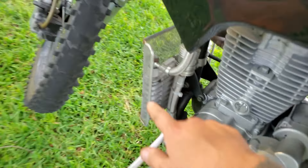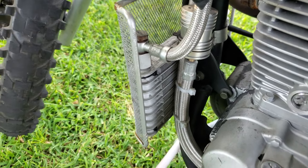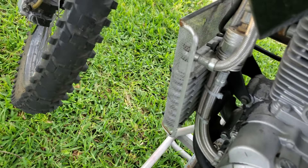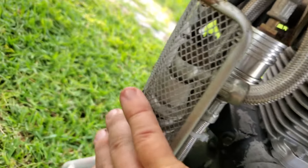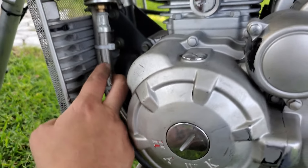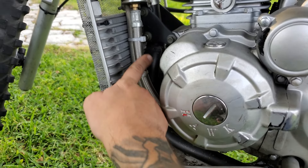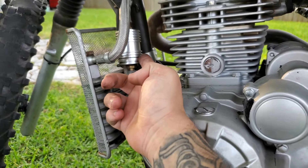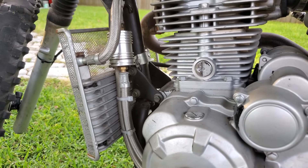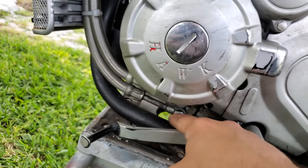The oil cooler is still doing well. Most people can probably tell that this front screen I put on is actually just some kind of document organizer — I might put something else on there to make it look a little bit cooler. However, it has been doing its job and protecting it pretty well. I think I have to switch this hose with the other one because this is actually the return hose, so the oil is traveling up here and the oil filter screen isn't really filtering anything. I'm going to double check that and swap them around.